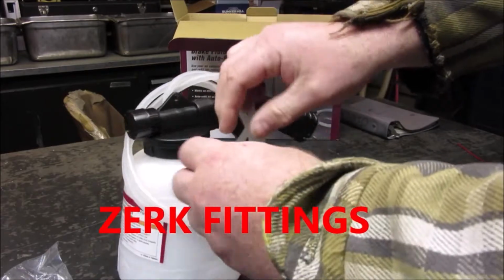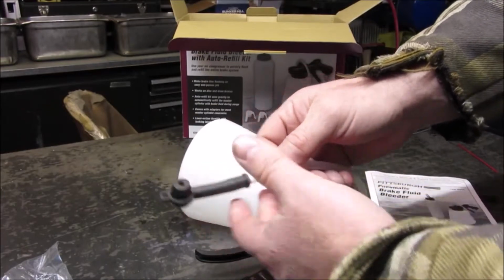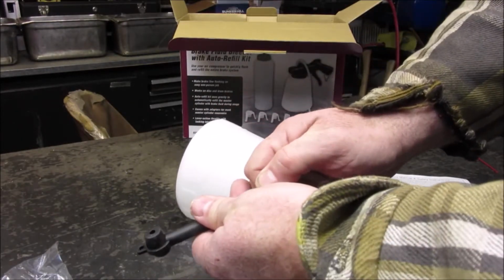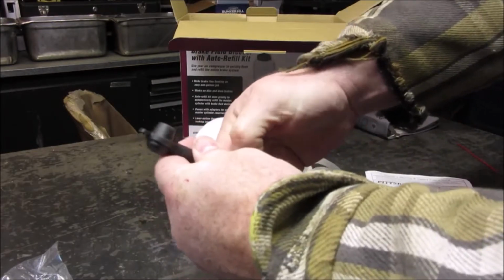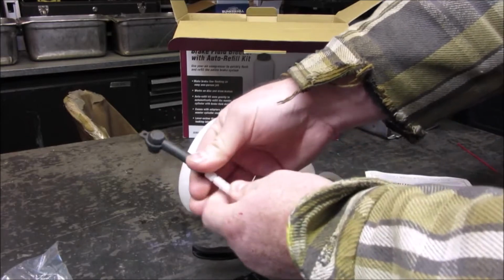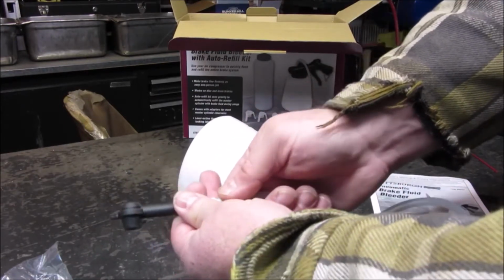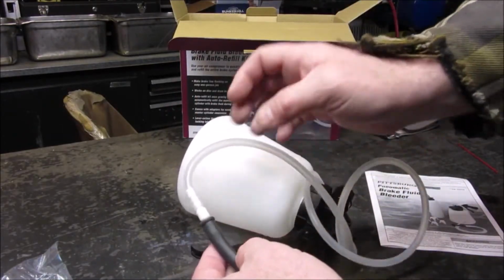We'll see about that. Something else I see, when people go to suck stuff out of the brake reservoir, either they use something else, which doesn't really make sense if you have this, or they just stick this down inside there and suck through here, and this actually should come off of here. Should and will are two different things. Now, it might not come off so easily, which may be why people are doing that. So I'm going to mess with it. When I do my brake bleed video, you'll see if I get that off. I'm sure I can get that off fairly easily, and it should go back on just fine. But anyway, I would just stick this section down in there without this piece, and suck stuff out.